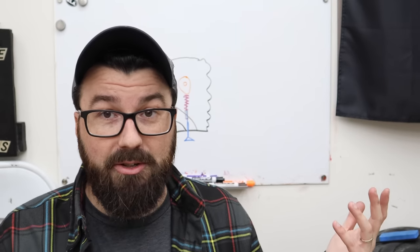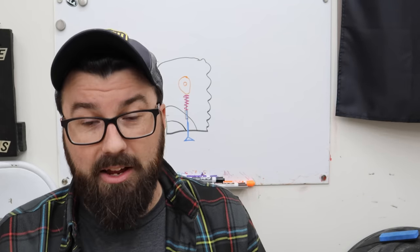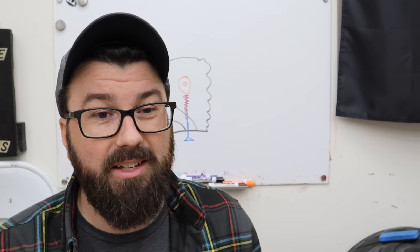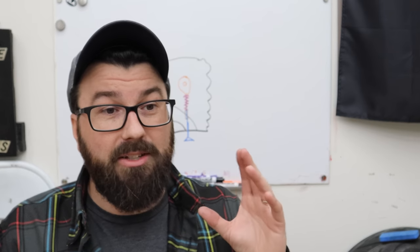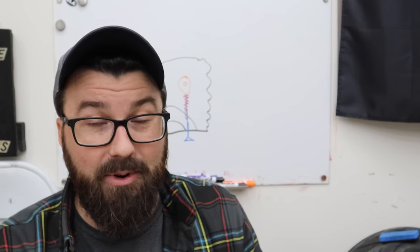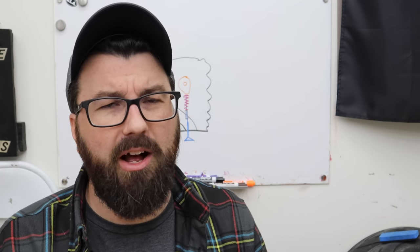I asked Ari if this head would actually be good for all-around power. He said yeah, it's a pretty good mix — even in race bikes they don't typically blast the ports out. You do want good power throughout the rev range. Making a cam that has more aggressiveness to it sometimes requires stiffer valve springs and you start getting accelerated wear throughout the valve train. But this cam is not aggressive enough to even require stiffer springs than what it came with. Ari says he just ran stock valve springs and did not have valve float — and again, this is someone who ran these engines near redline all day. That makes me feel better about running those cams, though it's still a bit of a mystery. Stay tuned.